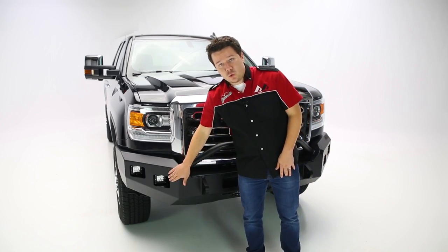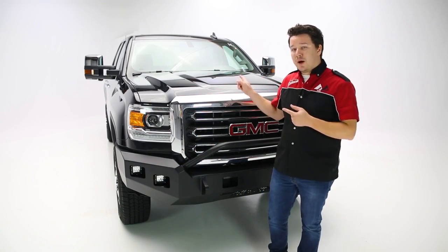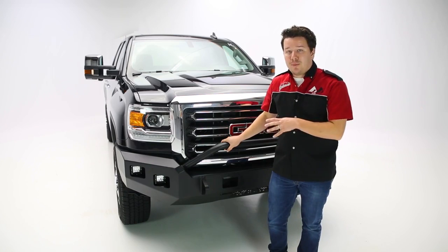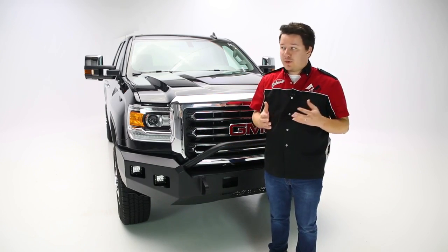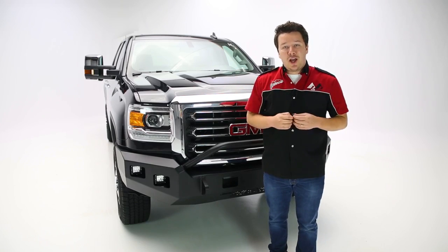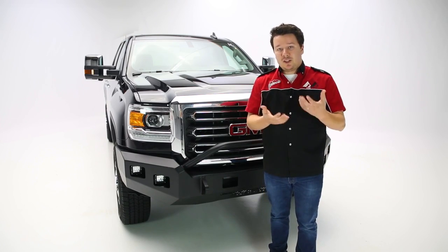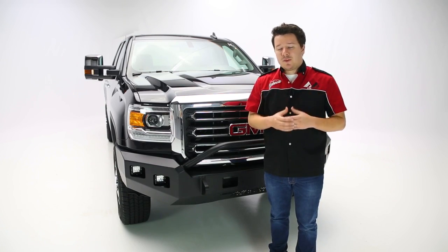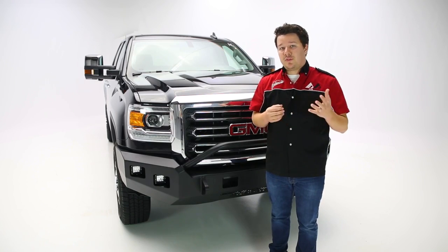There's also some wiring required on the front and rear bumpers. The rear bumper was quite a bit more difficult than the front for one big reason — the factory receiver hitch. Because the rear bumper retains that hitch, you actually have to take the hitch off, take the factory bumper off, put the new bumper on, and then remount the hitch. It's a bear of a project — very heavy — and that four-step process is what makes the rear a little more difficult.